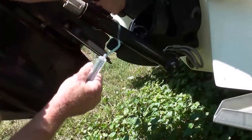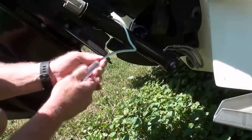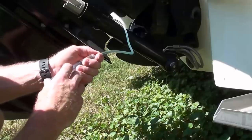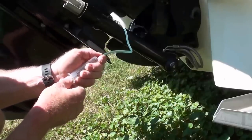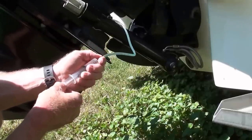This is going down into the lower unit — this tubing is connected to the lower unit. I connected the syringe and I started pumping the Dawn detergent solution in. It was kind of hard to press it in at first. Then I just used the pumping action to pump that Dawn detergent and warm water down into the blockage.